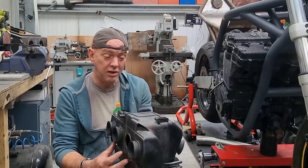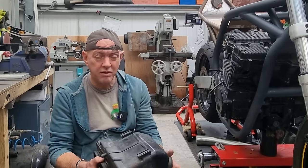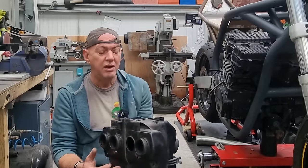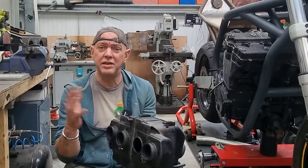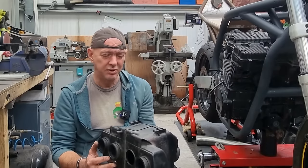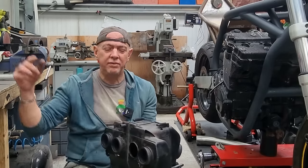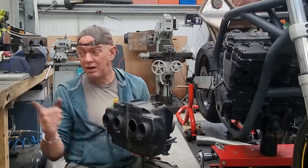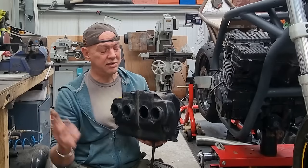The second thing is the volume of this thing, its physical size. How much air can you fit in there? That again is quite important. It was going on about loads of stuff and I don't get it. I'm not an engineer, I'm not a mechanic, I don't understand this stuff. But this is actually like a resonating chamber as well. It's all to do with fluid dynamics and volumetric efficiencies and God knows what else. But essentially there's a pressure wave that is bouncing about in here, and if you were to look at it, it's like a sine wave or something. Because of its size and its shape, that pressure wave is kind of timed. So clean filtered air is presented to the carbs in just the right condition for the carbs just to suck it in as they demand it, basically.